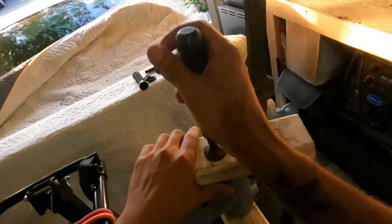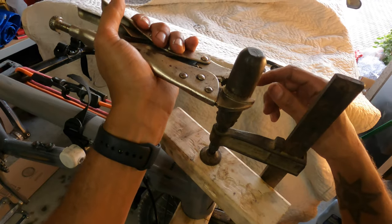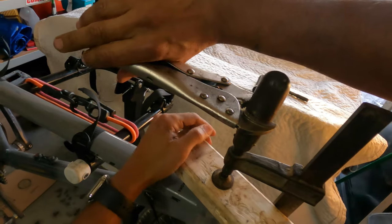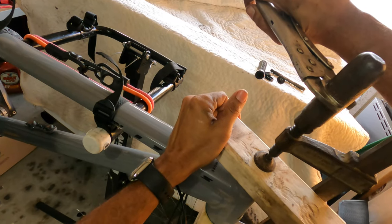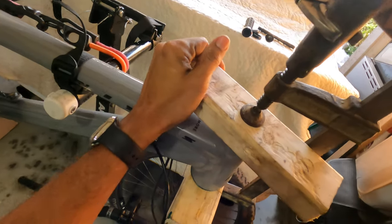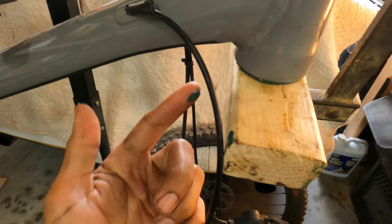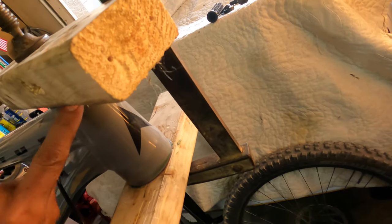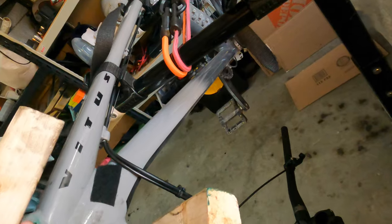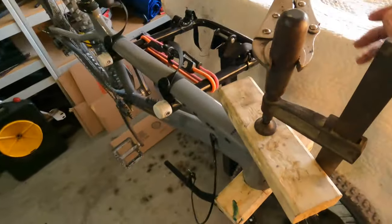It's just about in. All right, so I did have to get a pair of vice grips here to grab on this handle because my hands are slipping due to the grease, but let's go ahead and give it a couple light turns here, nothing too crazy. And there goes all that grease squeezing out of those cups and the frame. And that's how you know you're well seated in the frame. Let's go around it real quick, make sure all that grease is squeezed out, everything's sitting flat. And we'll go ahead and take this off.